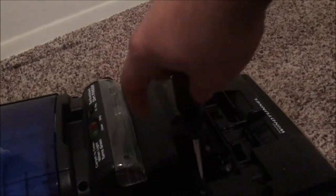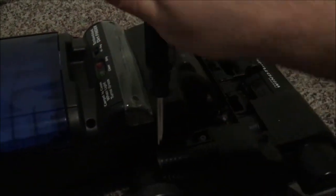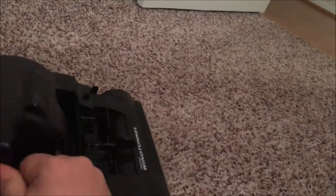Once it's back on its front side and you've got that whole tube removed, keep your screws together. I like to keep them with certain parts: the four screws to the bottom plate I kept with the bottom plate, the two on the hood I left with the hood, and the two screws for the wand I put with the wind tunnel channel piece so I know where those are. Now you're also going to want to remove these two screws that hold in where the motor sits.